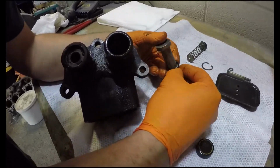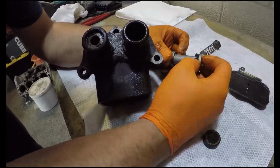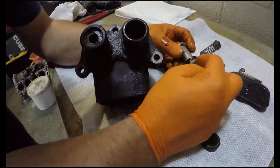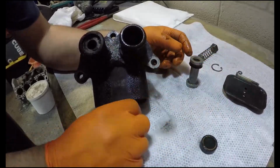It just takes a small amount to wear that away, doesn't it? It'll only take one little bit of dust or burr inside there to repeatedly wear every time you push the pedal. So that over time will create a back feed, so the pressure it creates bleeds back into itself again, so it effectively doesn't pass the fluid. And that is my problem.